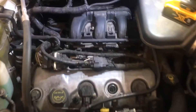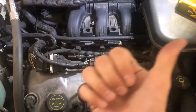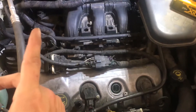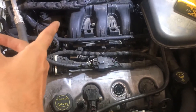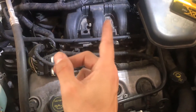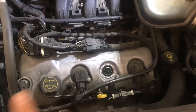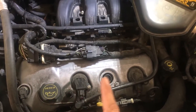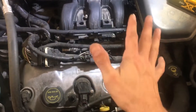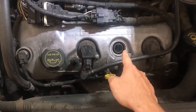Looking at the front of the car — passenger side on the left, driver side on the right. According to my book, cylinder numbering starts at the back on the passenger side as number one, then two and three across the back, then starting again on the passenger side: four, five, and six. So I believe circuit E is number five — A, B, C, D, E — and that's the one showing up on my scanner.